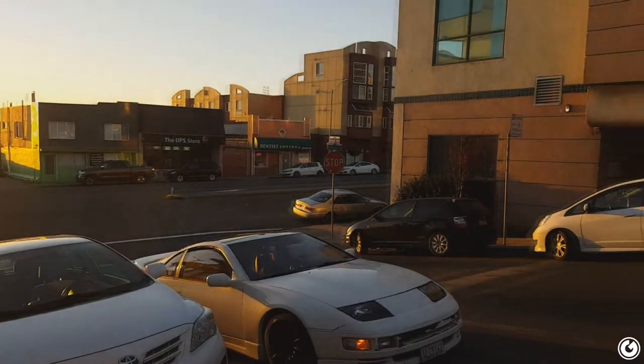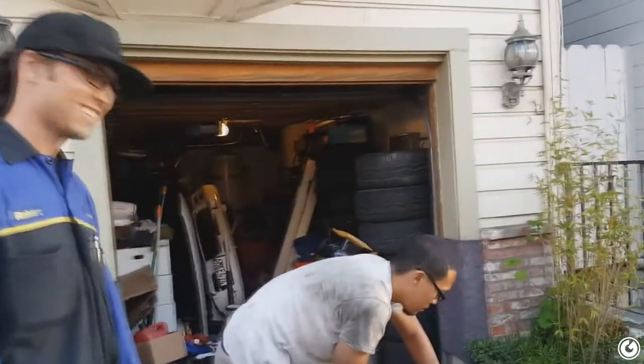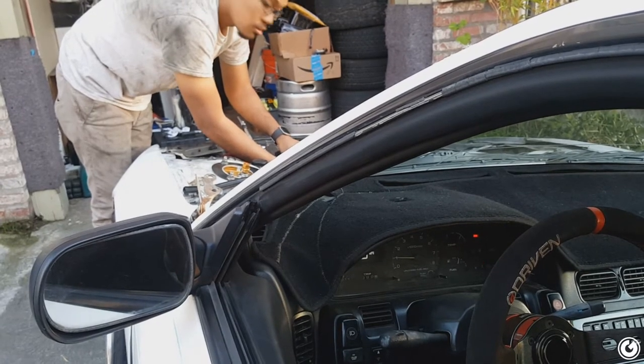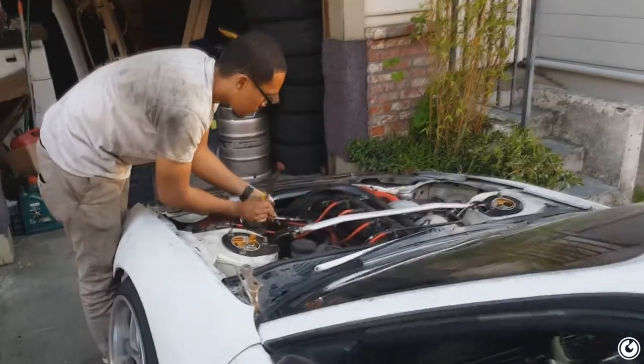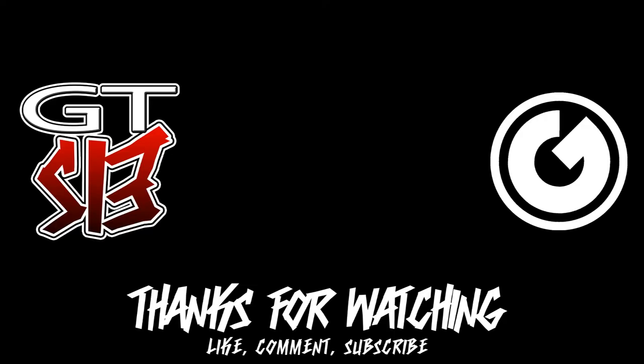And look — it's our friend Rob the tire guy with his twin turbo 300ZX. What's the stock idle for a 240S supposed to be? We're at 1000-1100 RPM — and that's how you set an idle, just adjust the distributor and tighten the bolts back. Alright, I'm going to close out the video here, it's starting to get dark. Just got to put the bumper back on and the side skirts. The exhaust is on, all the problems are fixed, the car idles good, we readjusted the distributor — everything is good now. Until next time!